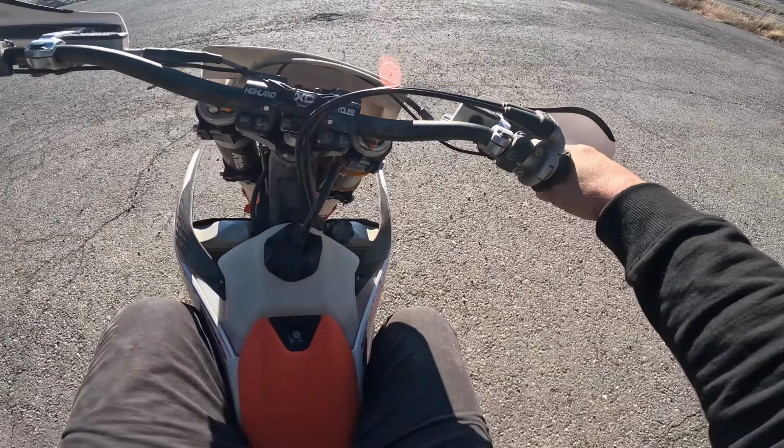It's not like a turbocharger or anything like that, but that also could be my buddy. If you haven't watched the SXXC video, make sure you do, because we talk about how the power feels very similar on the two bikes, but this bike has a high compression head and that one didn't. They both came with an SX head, but I put an RK Tech head in this. It gives a little more bump everywhere because it's high comp and his head design has different squish and all that stuff. So that would make sense that they would feel very similar, because the other had a head that didn't. And I'm thinking the SX models might come in that hot map, whereas these don't.